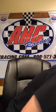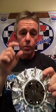John, we've got them for the 390, buddy. The 6615-H3 is the drag design, the finless design. The 6617-H3 is the fin design. The 6615 and the 6617 both are adjustable flywheels. One's got fins, the other one doesn't. Both of them will come with whatever coil bracket or coil adjustments you need, just like this one here for the animal.